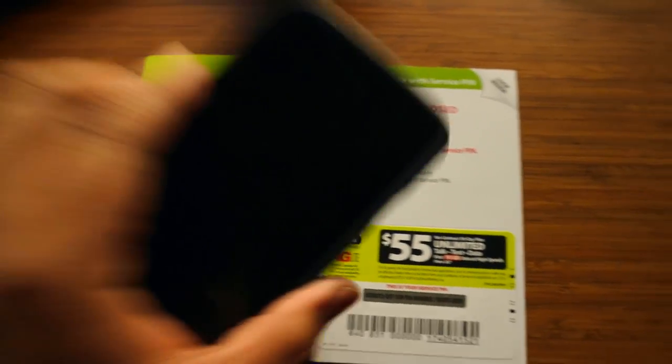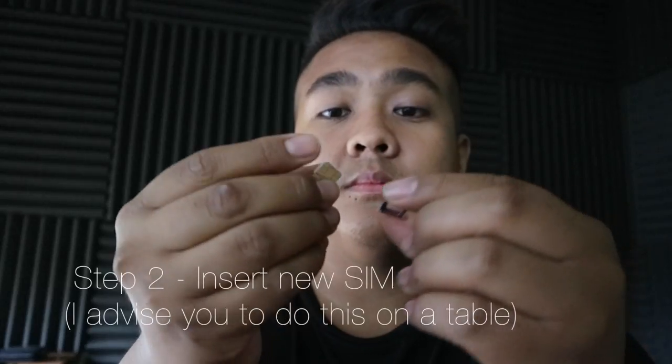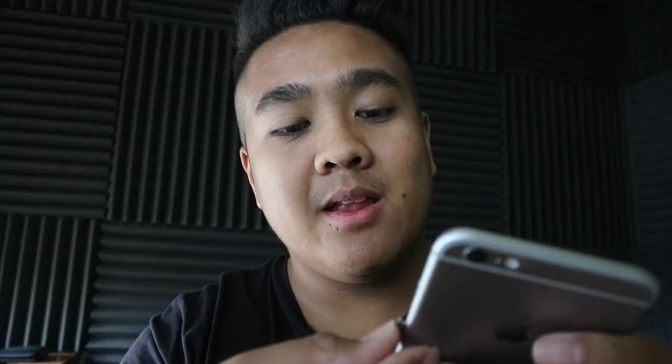Alright, let's get started. Got my iPhone right here. I need to take out the case. We have to find that little spot — find that little spot right there. Pick the compatible SIM card first, and then see how big it is using that little thingy. Take that, pop open that button. There, see — take that out. So now it says no SIM card installed. I'm gonna take out the little chip, match it, put it together. Remember when SIM cards used to be super huge back in the day? So now I'll put this back — gold part facing down — put it back in and stick it through.